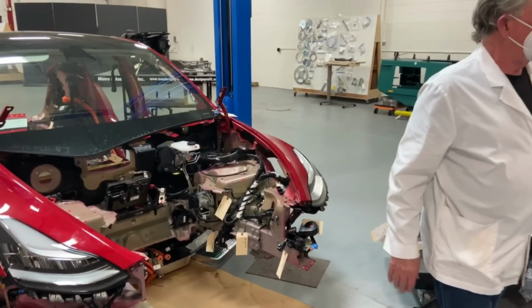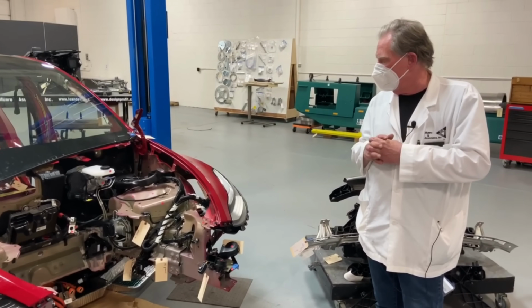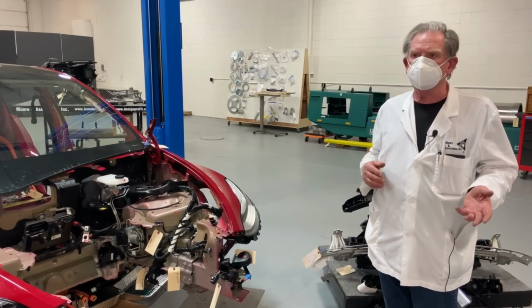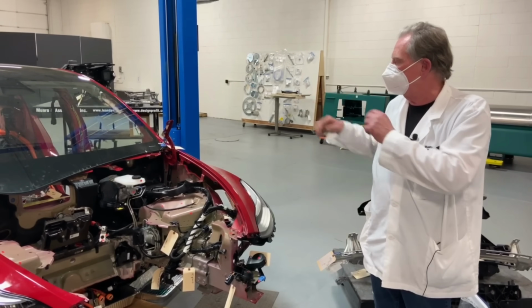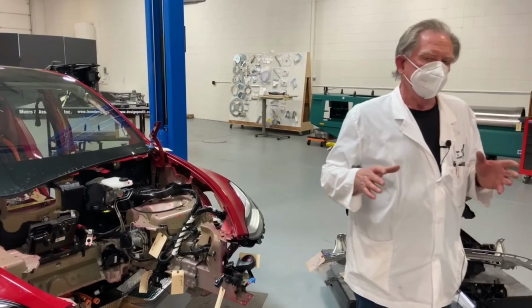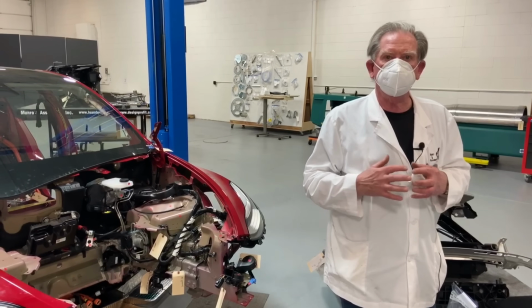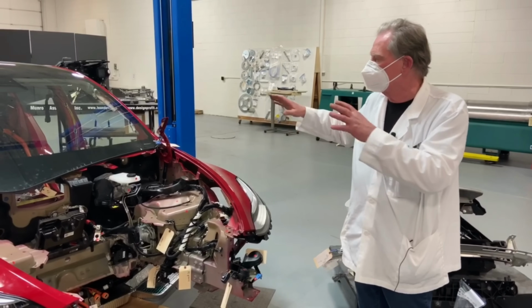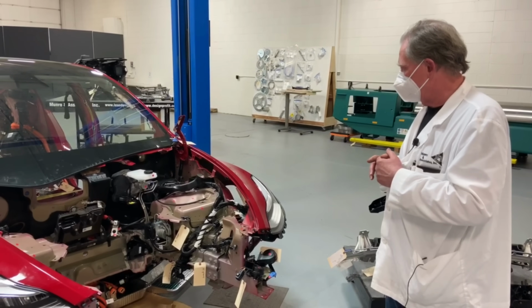Well, the reason is basically because there's no alternator in here. Something has to keep things charged and whatnot. So I have to have a bunch of different voltages inside this car. Sometimes it's 400 volts, sometimes it's only 12 volts, sometimes it's less than that. So the DC-DC converter back there and the PDC, the power distribution center, they take the place of the alternator and all the other electronic devices that would need to be in place for this module to work and for us to get power distribution where we need it. Now, right now it's running on 12 volts, and that's fine, I guess.